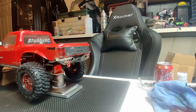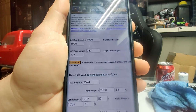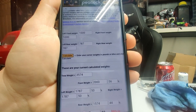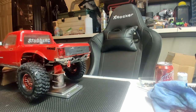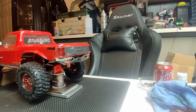The other option we have is to lose some rear weight. Probably could have a little bit more accurate scale setup, looking at maybe getting some corner scales. But at the end of the day, we really want more forward bias. But this truck doesn't even want to tip back, because we're so low CG, because of the battery tray and everything else, until 60 to 61 degrees.